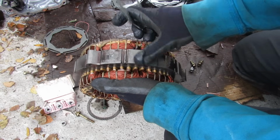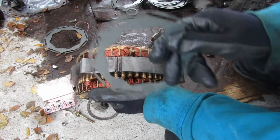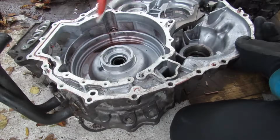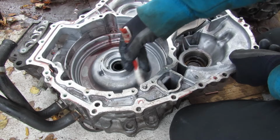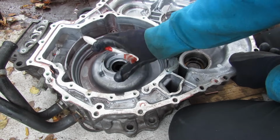And you can see similar to the rotor, we've also got a core here that's made up of a bunch of small steel plates laminated together. Now inside this casing, you can see we've got our 2 coolant hookups here, and that's going to go to a giant cooling compartment in behind where the stator sits, and that's going to help cool down MG1.